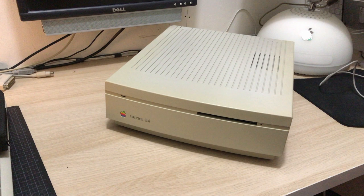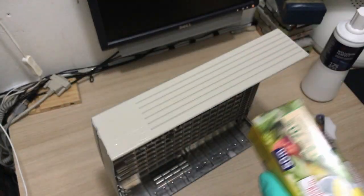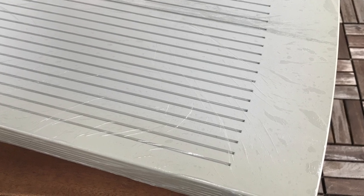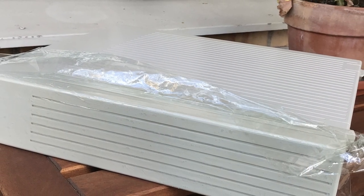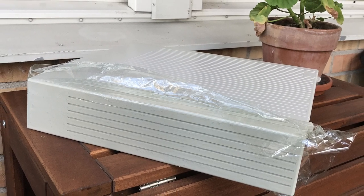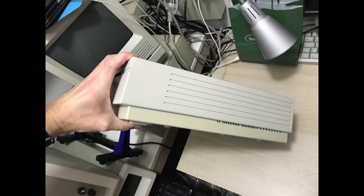I read that someone had successfully retrobrited with cream on the balcony without direct sunlight, so I decided to learn from my mistakes and take it very slowly. I applied a thin, even layer of hydrogen peroxide cream with a paintbrush and put cling film on top, making sure there were no creases or air bubbles. I kept it in the light on the balcony but out of direct sunlight for five to six hours at around 20°C (68°F). I did one side at a time, rinsing thoroughly before doing the next. On one side I had to repeat the process twice because it was quite yellowed — so this was not a quick fix and took several days.